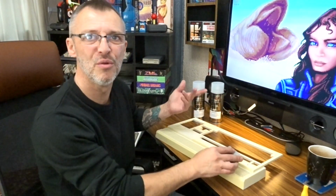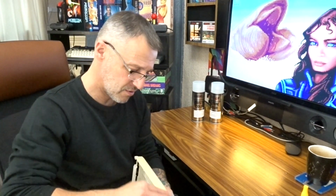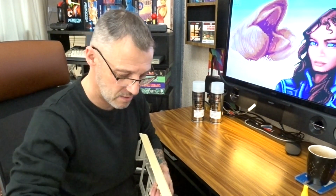What you do to scour it is so the undercoat will key to it a lot better. It will key to it, but if it's totally shiny and smooth, not as well. You're not sanding the colour out of it, just scouring it lightly. I mean, 600 isn't the best for that. You probably want about 300, 400 grit. 600 is a little bit too fine, but it's good enough. Apart from that, I ain't got any 400 grit.